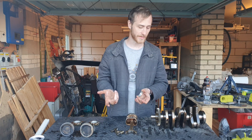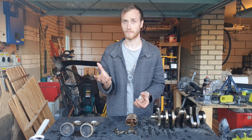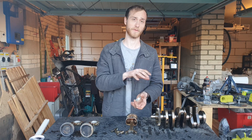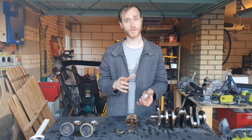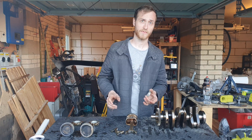This is as opposed to damaging the actual crankshaft, which is far more expensive and can cause warping and scoring — which would need the crankshaft replacing, or if it's not too bad, it would need re-grinding around the journal.